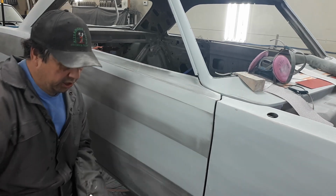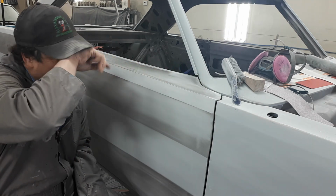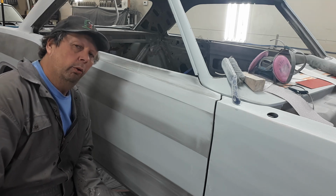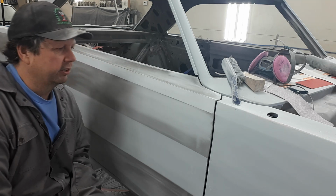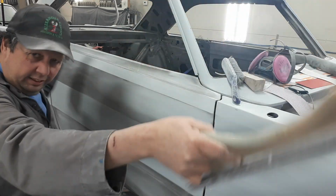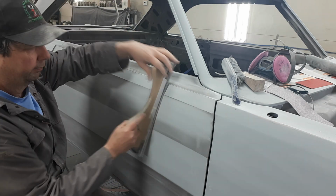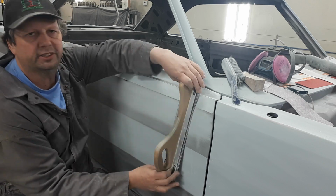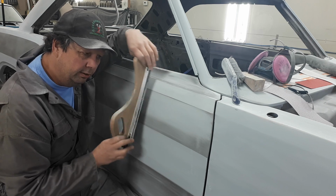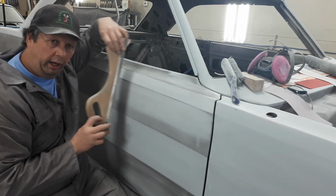Now again, like I mentioned before, I don't get a lot of what you see. There's video after video of people block sanding and doing bodywork. And they'll show you their big long handboard, 7.5, 8 feet long. And they'll take Mr. Great Big Long handboard and put her on the surface and start sanding like this. Well, if you've got some waves there and you're sanding like this, your board's going to do this through your waves, right?